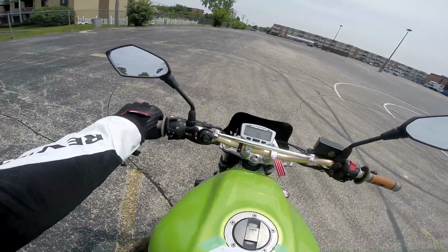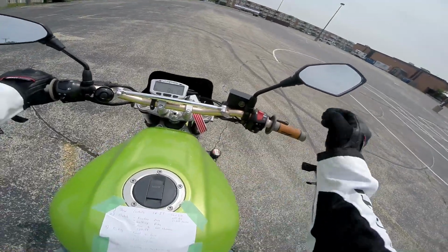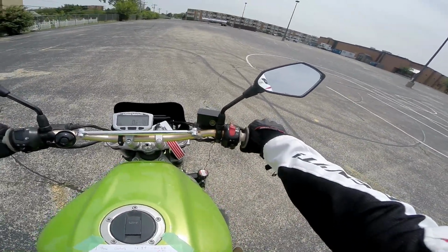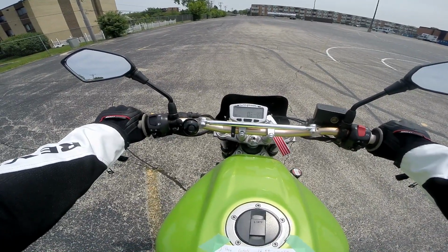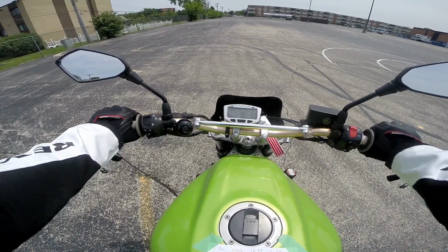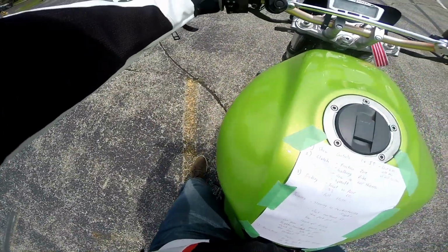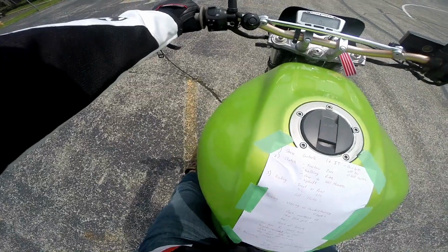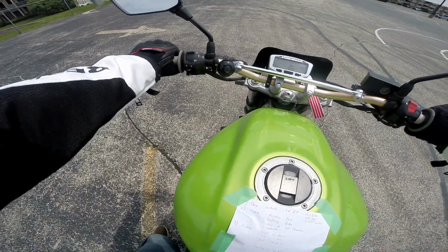And then what you can do is what we did in the motorcycle safety course. You can put your hand here, don't throttle, just something to hold on to. You just find that friction zone and let the bike roll forward, get a little stretch in your legs, like I didn't move, and you just let it roll back. Now, clutch out, roll forward, and back.